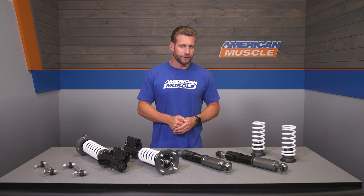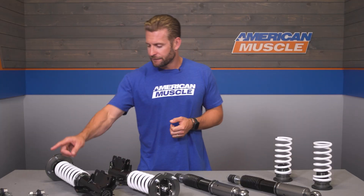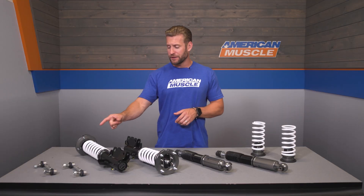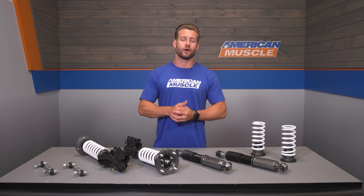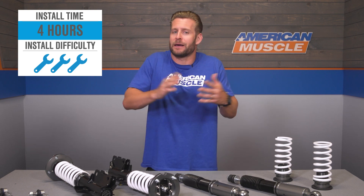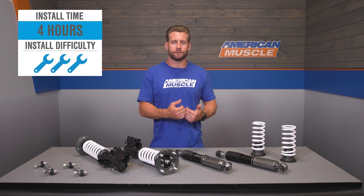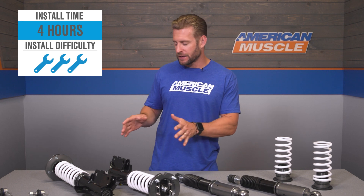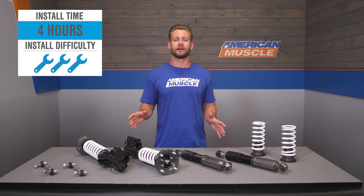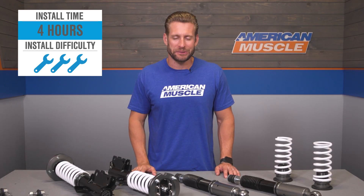The V2s from SR also include aluminum top hats — or caster camber plates — built in, which is a nice feature. And they even toss in some burly adjustable end links for the front sway bar, a necessary feature if you ever want to corner balance the car. As for installation, the benefit of going with a coilover like this is that you're simply yanking out your front strut assembly in one piece and replacing it with the entire coilover up front — no need to mess with spring compressors. Here's a detailed walkthrough along with a quick tool breakdown.